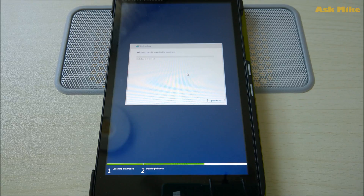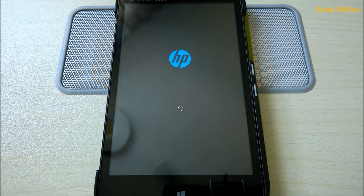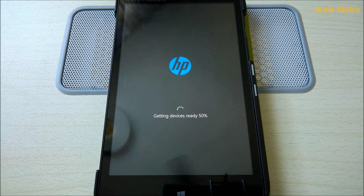The difference between clean install and the upgrade process is that with clean install, once you get restarted into the second screen, you can most probably unplug the drive. Just remember, when you finish the process and the machine is restarting, there is a time when you should remove your USB drive so that it boots into the standard setup process rather than booting via the USB drive again. Now that it's restarted after I removed the OTG drive, it's continuing with the setup. You can plug in a charger to your tablet now so the tablet doesn't shut down midway.